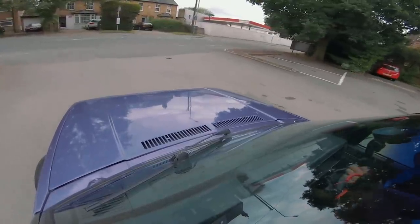Okay. This one you can actually disrespect a bit more, Gurpal, yeah? You can, but obviously it's about an inch off the floor. So 280 horsepower? Yeah, it's got an electric accelerator pedal. When they mapped the car, they mapped that as well, so it's a bit more linear. They numbed it a bit. The throttles are really sharp, so in a light car it will just be really jerky to drive.